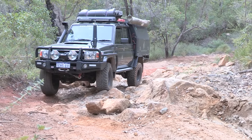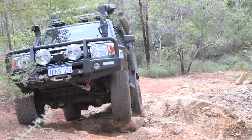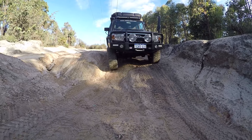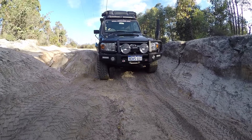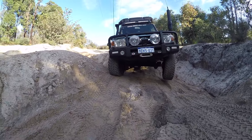Another reason is going up hills — you can use front and rear lockers. However, if you need to turn on the hill, flick your front locker off, which is quick to do. You can get away with just your rear locker most of the time. Going downhill, don't use your front locker — just use the rear locker. Rear locker only for downhills: it keeps the vehicle nice and straight and helps prevent sliding. On really uneven terrain like I just drove up, it's also good to keep the rear locker on going downhill so the vehicle doesn't shoot away from you.